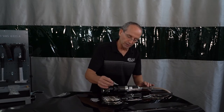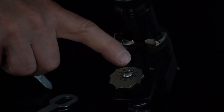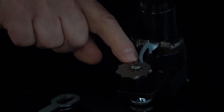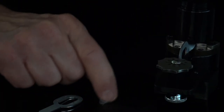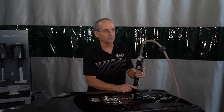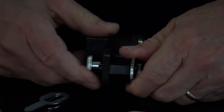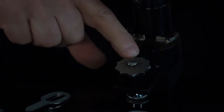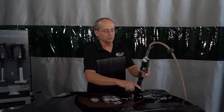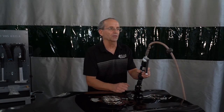On the half-twist ones, it'll do the same thing — it just sits in there a little bit different. The piece will go in the same way, and there's a little groove that the side of the piece will drop down into. Drop it down, make sure it's back on number one and same thing again — another piece trimmed off. When you are done with the first round of cuts on all your bits, we go to number two. The way that we go to number two: there's a little pin on the bottom that you pull out, then rotate this and let that lock in. Number two is now showing with the groove and that will be your second cut. It's easier to do your first cut on all your tabs first and then go do your second cut — otherwise you're going to have a bunch of cuts mixed up. Try and keep them organized.